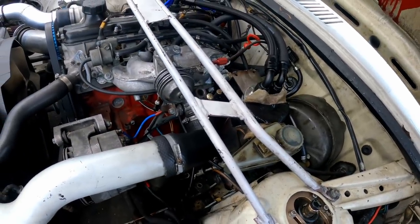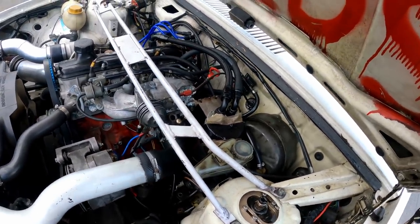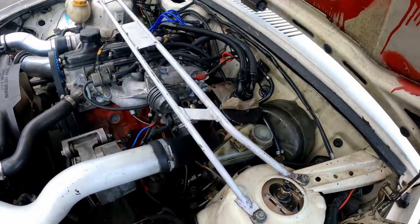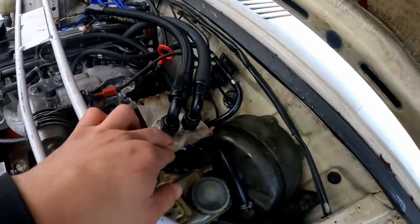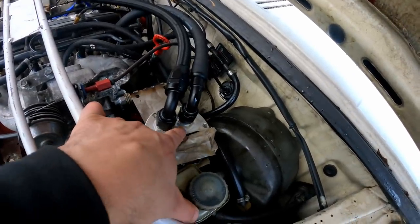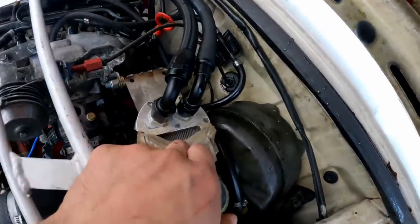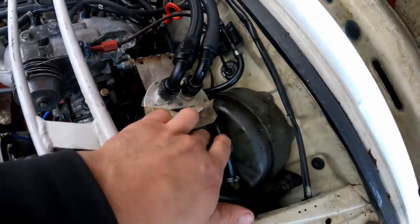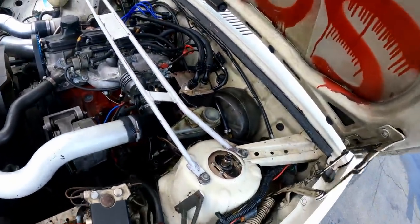So, it is what it is, but the good thing is the oil is going back down to the pan, and you'd think that this would be really bad because it's putting moisture in the oil, but the oil's so hot, you've got to remember that the moisture evaporates really quickly. What we're seeing right here is just a bit of moisture buildup mixing with the oil and coming out the catch can breather here. No big deal. I know you guys are thinking, oh, that's gross, but it's to be expected